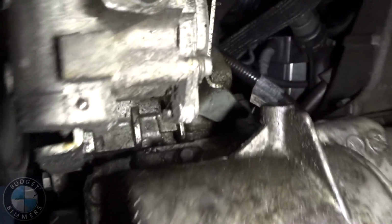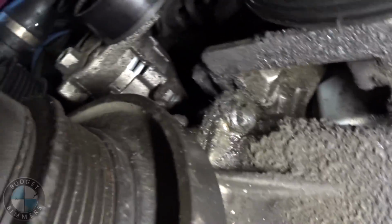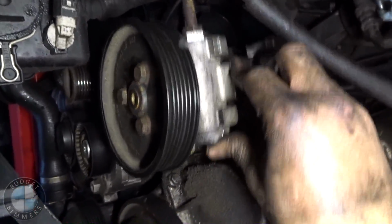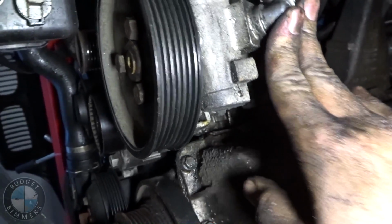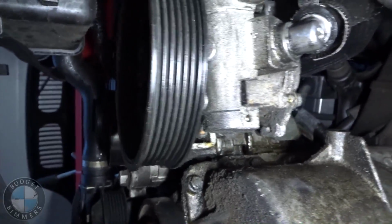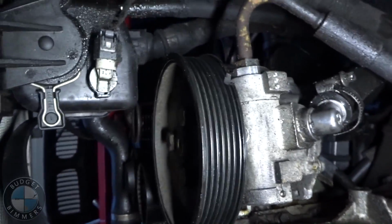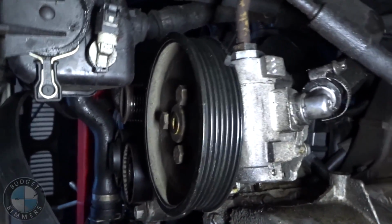And so if you just take the bracket bolt off right there, and this top corner one right up there, you can reach it better from the top of the engine bay. But if you just take those and then you loosen the third nut, you can swing it out of the way. So we're good to go. So you don't have to drop the whole thing, which is kind of good because it sucks lining it up. But if you need to do your power steering pump, we got a video for that. Not gonna put it in the description though, so go find it.